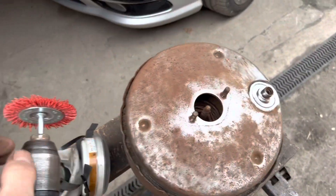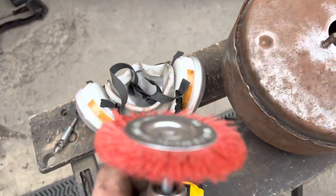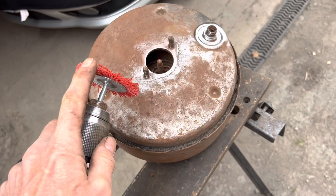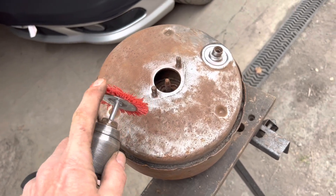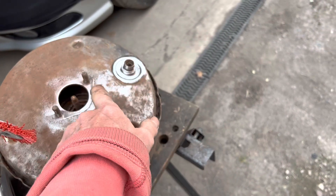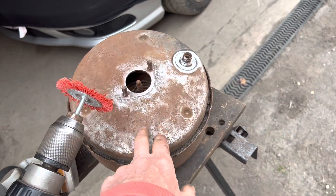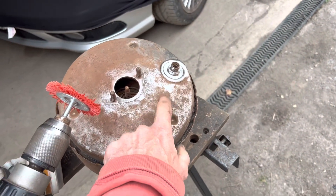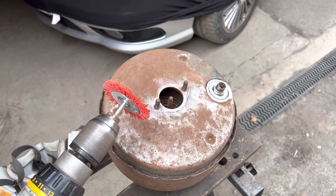I've started to get rid of all of this surface rust just using one of these Abrax fibre wheels. The advantage of these is — incidentally, if you're doing this at home in your garden — this doesn't shed bristles that you're going to step on with bare feet. Plus it's really flexible to get in all of these threads and it's not too abrasive either. So we're going to do a mixture of brass wire wheels and these Abrax wire wheels to get all this surface rust off, and then just spray this up with some rust encapsulator and top coat it with chassis black.